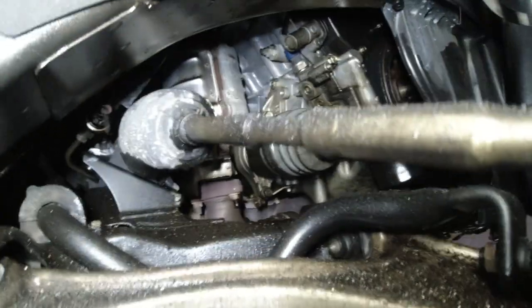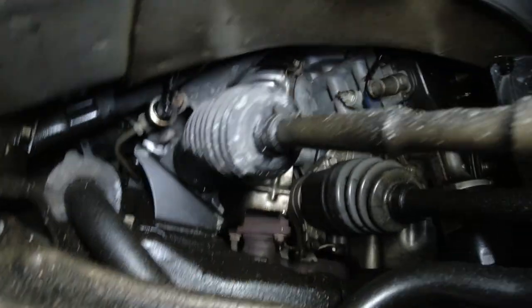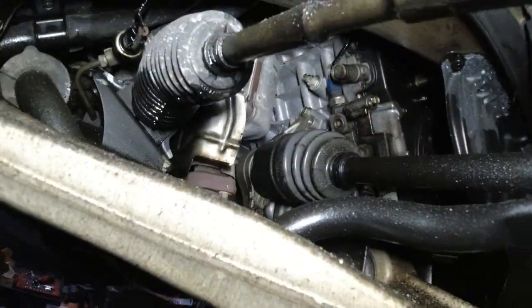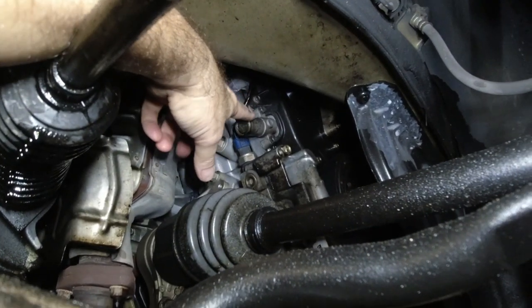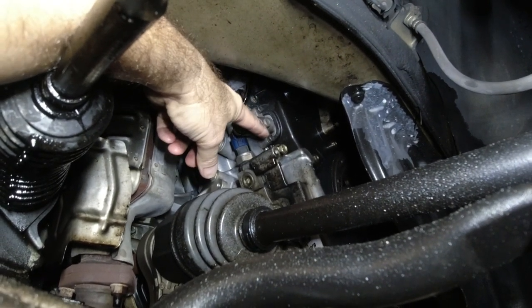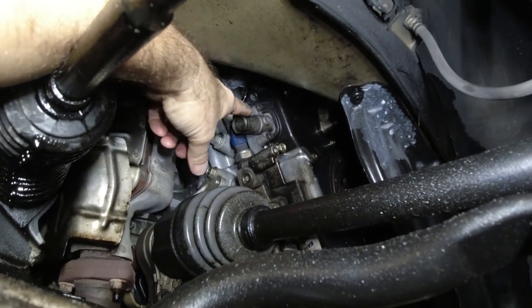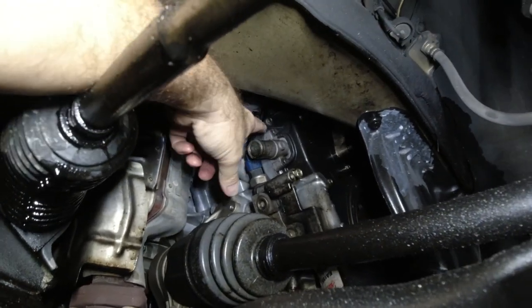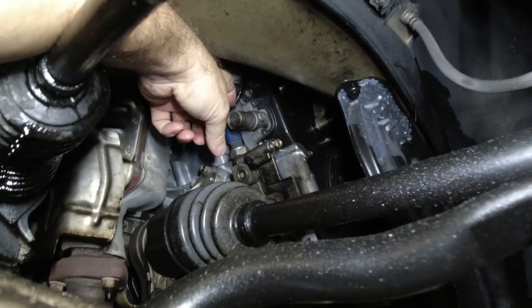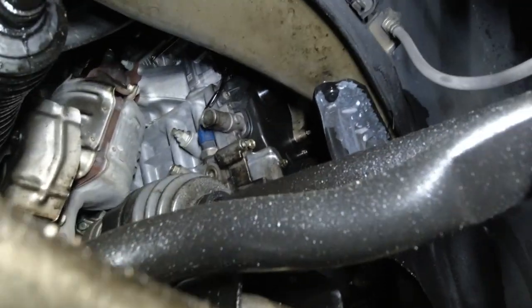As you can see, there's a little bit of an oil leak under here — this is not going to be a clean job. Right here is that tensioner. It's two 10mm bolts. I'm going to get a large socket to put over this whole thing, and a little extension so I can pry it around if I need to. I'm going to take these two bolts off right there. Hopefully it just comes right off. I'm hoping I don't have to take the cover off, because it looks like the cover goes around it.